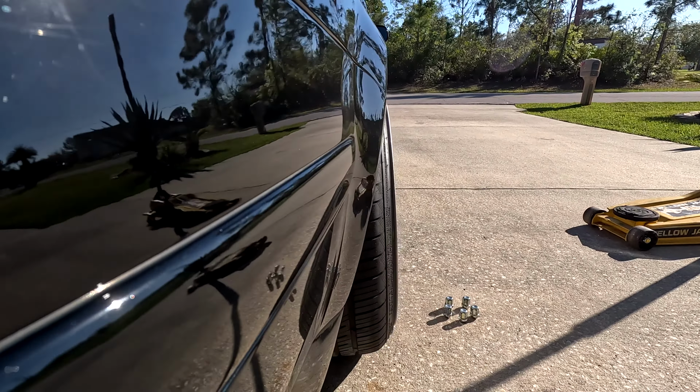All right, so what I did is either gonna work or kind of at a dead end for right now. Instead of cutting it all the way out, you can see I cut a section from the backside here. So that one bolt there is still holding all this up. I cut a section up to right about here, and same on this side, this bolt's still holding it up, and I cut a section from here to right about there. So now, when it pushes up, it's kind of like a relief, and now all this can flex on its own. You can see where it separates right there. More room to actually go up where it's not pulling all of this section, and this can move on its own.